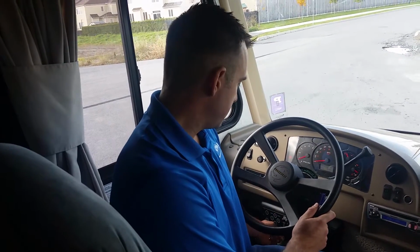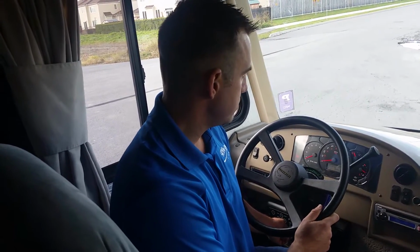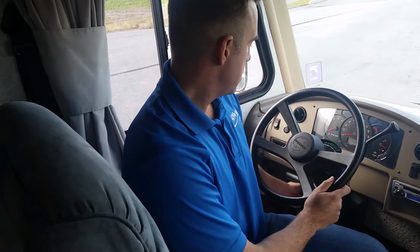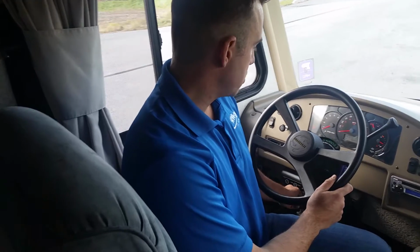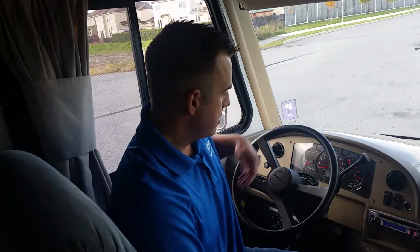So you're going to press the front jack button. You'll hear them lower. And they'll hit. And we're going to extend the rear jacks. Now you can level off left and right side using the buttons on the jack. I'm on pavement right now, so I have nothing underneath the jacks. However, if you're on a soft surface, there are wooden blocks underneath in the carrier that you can use underneath to support the jacks. All of this needs to be done with the truck turned on.